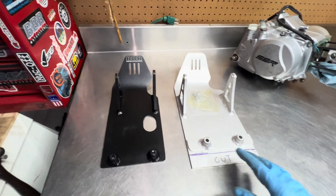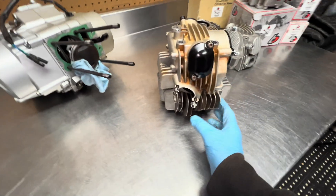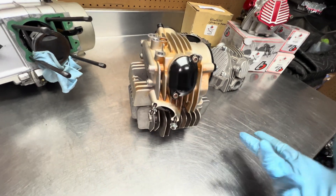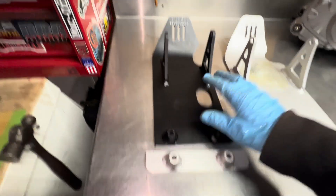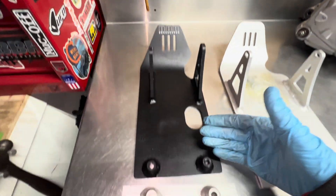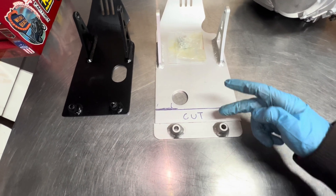Another thing people were asking me to make a video on — I figured I'd include this real quick. If I was going to use this head with a KLX cylinder, on the KLX cylinders and the TB parts cylinders the big bores will be a little bit wider right here, so you have to customize the skid plate. You could use the Daytona 190 skid plate and that works too for the older 150s. But if you already have one of these laying around it's not that hard to cut and modify it. This is the Honda one right here with the skinnier cylinder, and the KLX is much wider. If I was to use this cylinder I'd be able to use this whole setup right here no problem. But if I was going to use the KLX cylinder or TB parts bore kit, what you'd want to do is bolt this on the bike — because this is too long on the KLX, it'd be too far back.